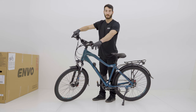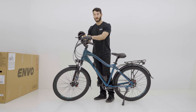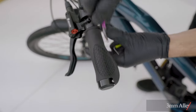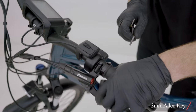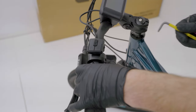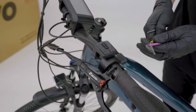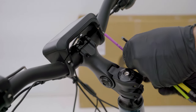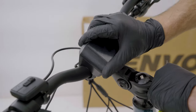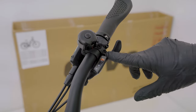We're also going to check our brake levers for pressure — which is good. So all we'll need to tighten is basically our bell and our display. We'll tighten the grips with a 3mm Allen key, check and confirm the throttle is secure — you can use your 3mm to tighten if needed — and tighten the controls with a 2.5mm. Moving to the display, we've got 3mm bolts here, so we'll grab our 3mm wrench, give those a tighten and put it back into position. We'll check the shifter, which is pretty tight, and use our 5mm for the shifter, and use the Phillips screwdriver for the bell.